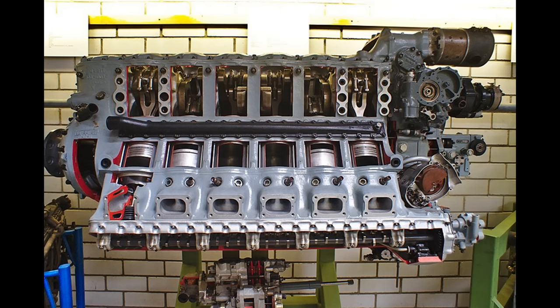Two-stage systems were very effective, and this is an area where the Germans had been behind. The U.S. had two-stage systems years earlier, and the British had it on the Spitfire Mark IX and subsequent models. The two stages really helped breathe life into the Jumo 213. I do think the supercharger impellers were a highly efficient design.